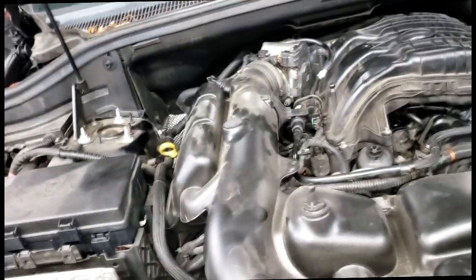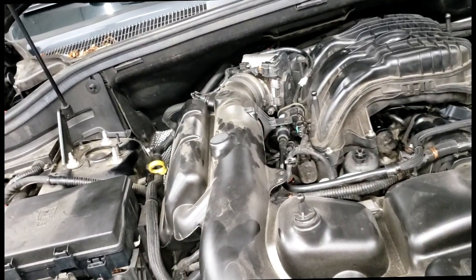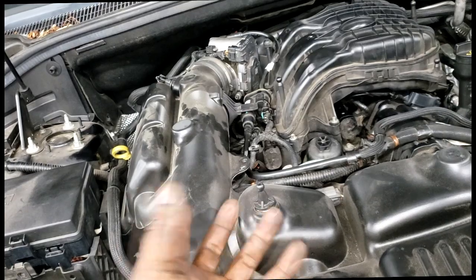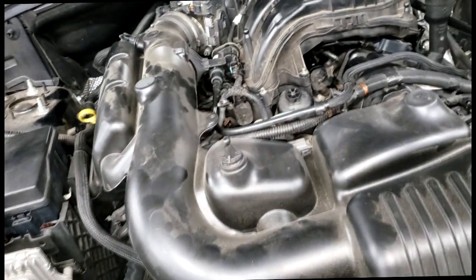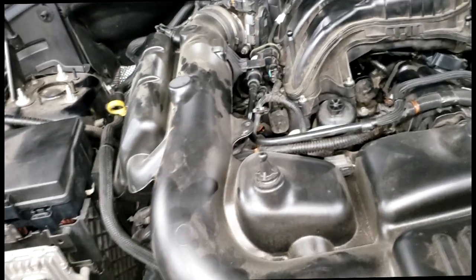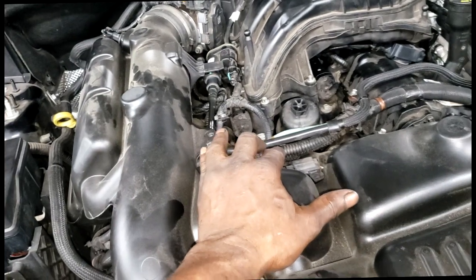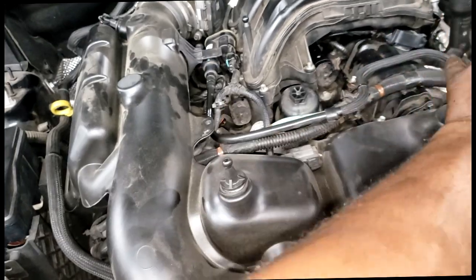Now, guys, what I'm gonna do is I have an option on my scan tool. I can clean these phasers. Okay, I'm going to relearn cam and crank. There are some things that are not just automatically done. Number one, you gotta verify. I can verify that the ticking is gone from a verbal sound standpoint, but I don't want to just give this back to the customer. I will relearn cam and crank. Remember, I just disrupted cam, so I'm going to relearn that via the computer. I'm going to reset adaptive memories, guys, and I'm going to clean the cam phaser.